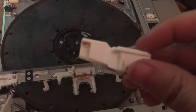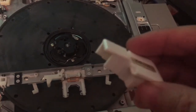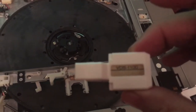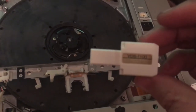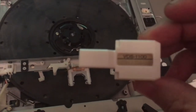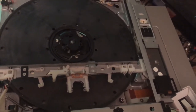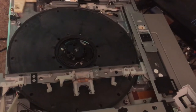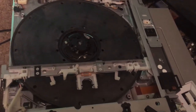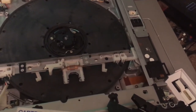As far as I know, there's only one kind of stylus cartridge that the Victor players use, and the part number on that is VDS1100, so that makes them a little easier to find. In comparison, I know of three different types of cartridges for the CED players, and being in America, those are a little easier to find nowadays.